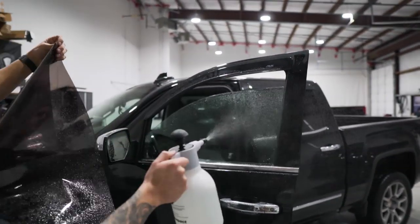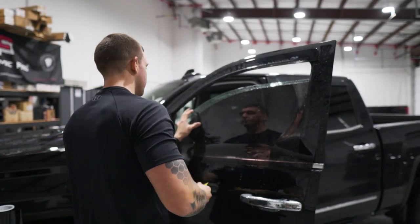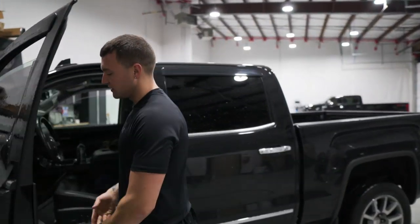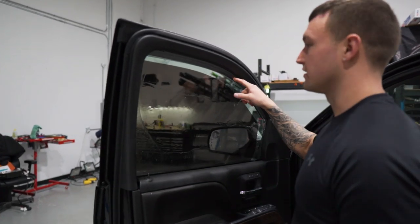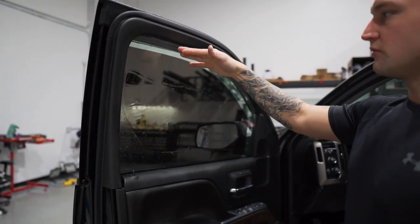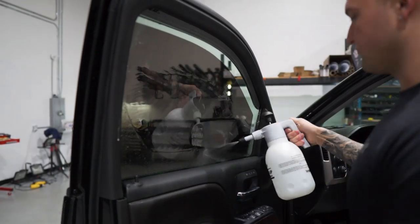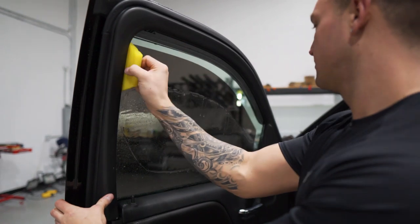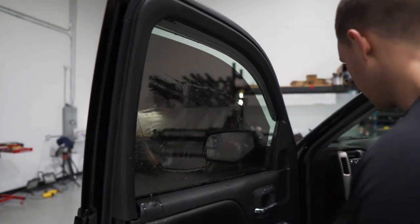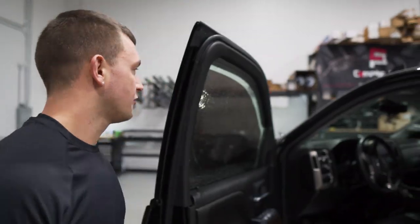Mount the material on the outside — one inch from the top, overhanging the back — just like any other front door window. Mount it in place, wipe the top edge, and roll it up to the desired installation height, which would be about an inch from the top. If these rain guards were bigger, you'd want to mount the film lower on the outside so you have enough room to work with — you don't want to stuff the film between the rain guard and the glass. Flush down the back, across the bottom, across the front, miss the middle, and squeegee that water off with overlapping strokes, down the back. Flush down the back again, across the bottom, across the front. Lubricate the center.